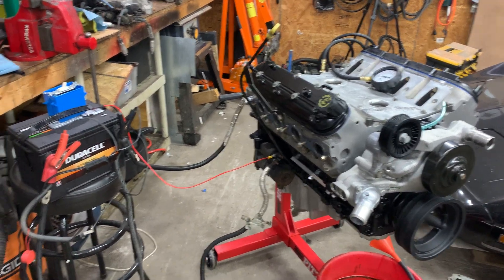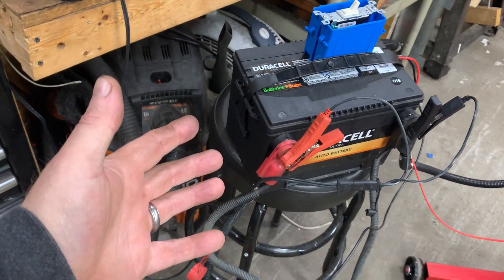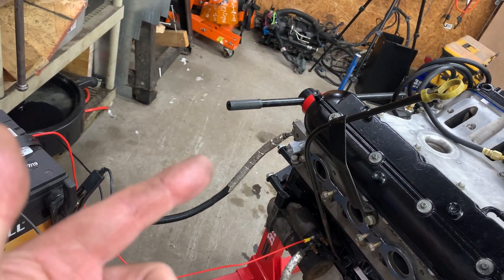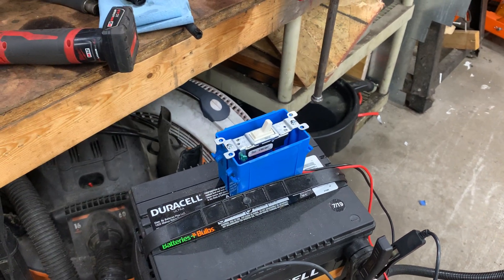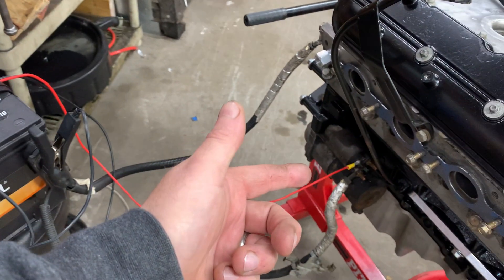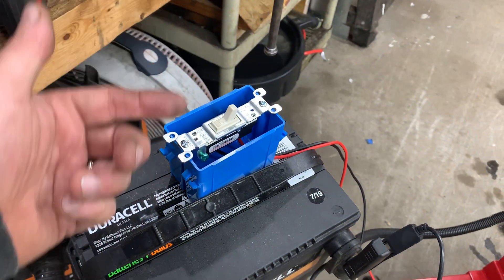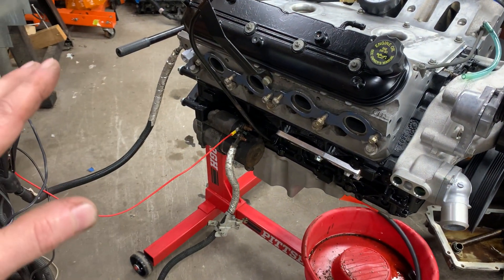What we're going to do is roll this engine over and confirm good oil pressure. I have it all set up — I've got the battery out of the Corvette and I'm using the factory wiring that came with the truck. We're going off the positive over to the starter, and the negative side to the back of the head. For the trigger wire I'm using a simple house light switch. It's a single pole switch with a wire going to the exciter on the starter and the other side going to 12 volts, so when I flip the switch the starter will engage and the engine will rotate.